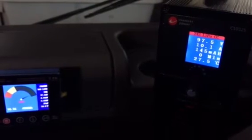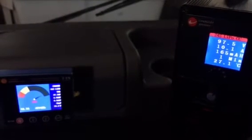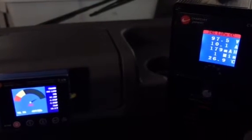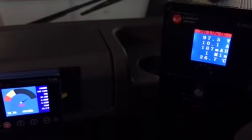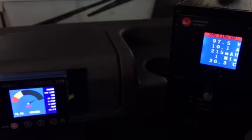It does have an onboard fan that kicks in and out depending on amperage. You might ask yourself why you'd need an off-board battery charger. A couple of reasons: you might want to quick-charge — you can run this at 25 amps while your stock Delta-Q does 10, giving you a combined 35-amp input if your batteries can take it. You also get more control over battery chemistry without having to reprogram the Delta-Q. You could also charge different battery chemistries you're experimenting with. This little suitcase unit is really compact — about the size of a small telephone book. That's it for now, hope you enjoyed it. Thanks, David.